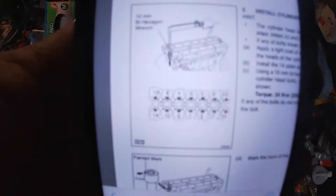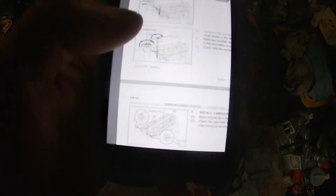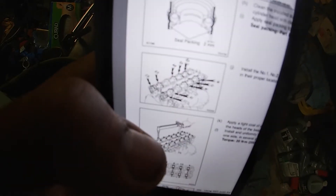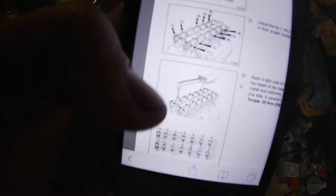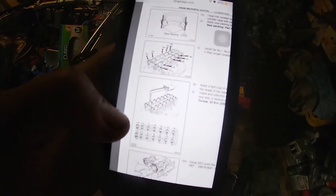So now it's time to put the cams back in. I'm going to show you the torque sequence for the cam caps — they all have their different numbers. I'll try to get a link in the description to the FSM so you guys can follow the torque specs. The 1JZ and the 2JZ have the same torque sequence and all the different caps are pretty much lined up the same. I'm just going to start torquing the cam caps on and coat everything with assembly lube.